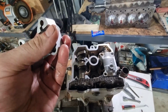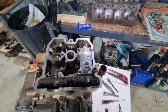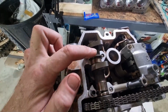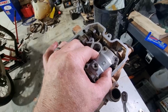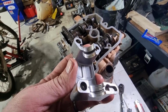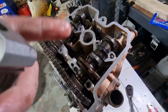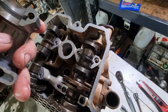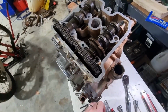What I'm looking for here is any galling. Ever so slight on that. And the camshaft itself. It's going to need a clean, I think. Yeah, on this rear journal there's evidence just of a little groove there. Oh, that would be consistent with the shape of that. Oh, hang on, no, it goes there. In that edge in here. Okay, bit of a cleanup required there.